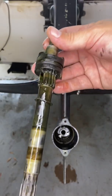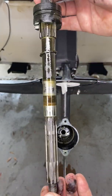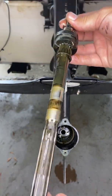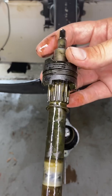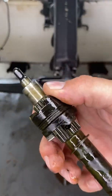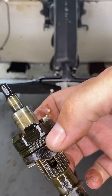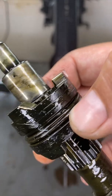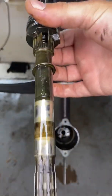We're going to take this shaft down to a propeller shop in Sarasota — they're just going to straighten it out for me. Because these are about $220 brand new. As long as your threads and splines are still good, there's no reason why you can't reuse it. I'm probably going to have to take this off before I take it to them — just start working this ring off, it's kind of like a key ring. Once you get underneath it there's a pin down in there that'll slide right out, and this whole mechanism can slide out so you can just bring them the shaft.